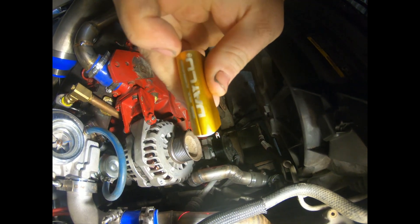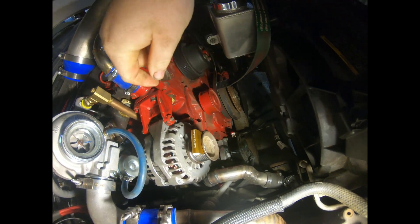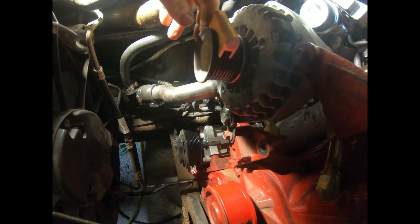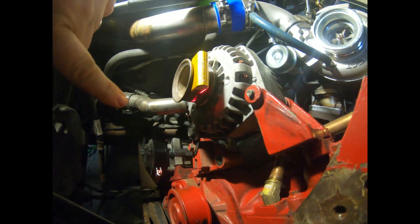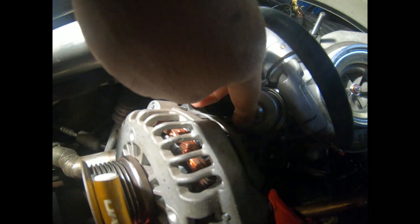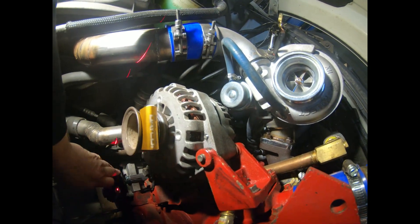This piece has a line on it and the laser is supposed to line up with that — you put them both at the same point on the pulley. As you can clearly see, it is nowhere near lining up — it's about half a pulley out. So we've got to make a new bracket for the alternator. This piece kind of has to go up and back, but the problem is the wastegate is pretty much right up to the alternator, so we're going to have to make a bracket that comes down and back to push the alternator back far enough.